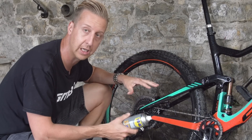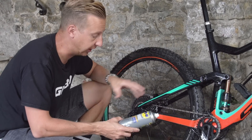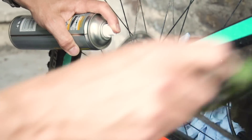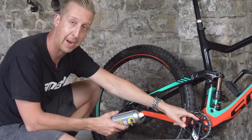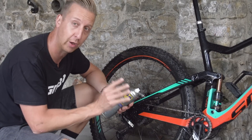When your bike is clean enough to start working on that transmission, the best thing really is a dedicated chain degreaser like this one. It is really important to note that with a spray degreaser like this, it's very easy to overspray and get it near your disc rotors, or also near stuff like the bearings around your bottom bracket — it's actually quite powerful stuff, so you really don't want to do that.